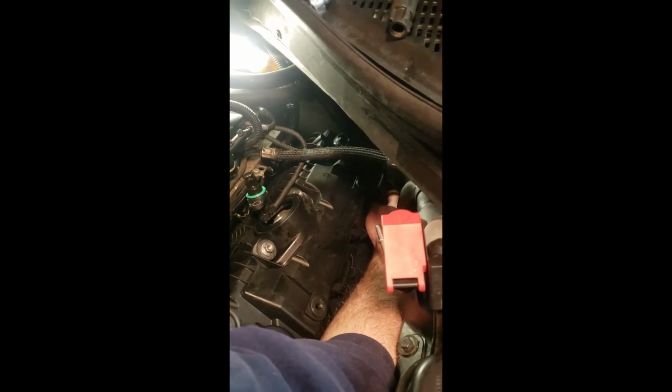Again, there's 2 different lengths. You want to make sure that you put the right ones in the right spot. It shouldn't be too confusing because there are only certain lengths. I like to start at the bottom because everything's out of my way. Again, verifying we have the green O-ring. We go to the lowest hole. We set it down in there. And when we put it down, you need 2 hands to basically seat it. A little rotation, a little firm. Got to get that O-ring back in place.